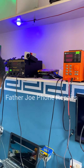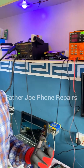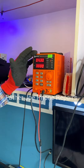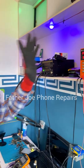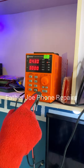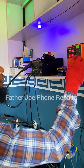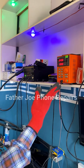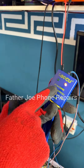We need a boot cable — this is our boot cable. Here is our DC power supply. Let me turn it on. You can see our DC power supply. I set the voltage to 4.3 — it is recommended to set it to 4.3. The amps is 3 amps, so I will reduce the amps because it's too much. Since the phone is having a power issue, let's use just one amp. It's on, and you can see the green light showing that there is power.